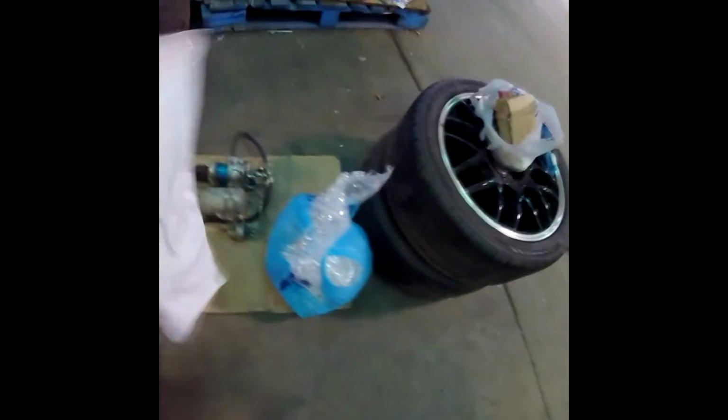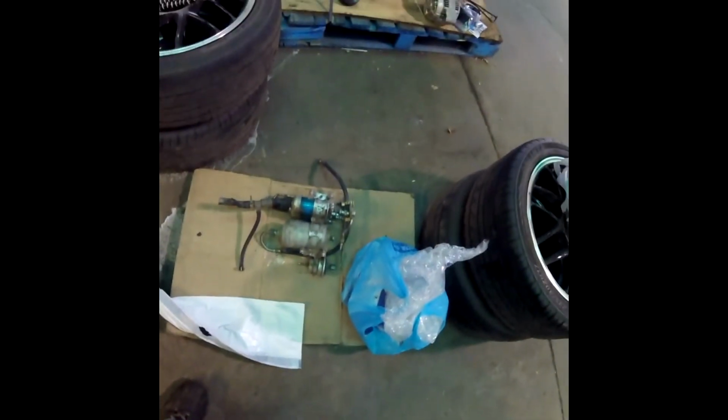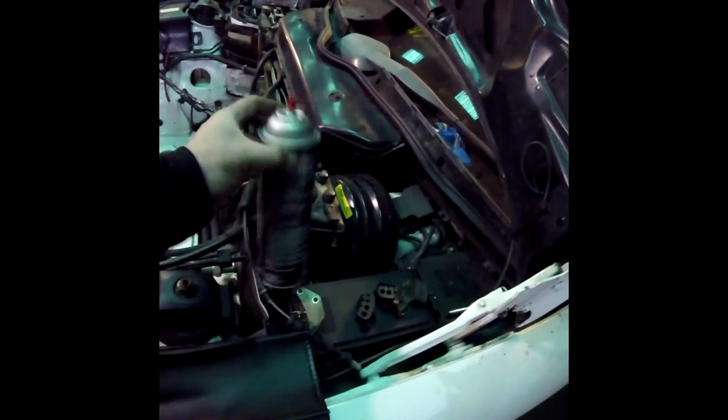I just pieced together the fuel system here, how it hangs underneath. You kind of see after I showed you. It's kind of a neat setup, especially for a 1990, but I'm keeping the dual pumps. I'm going to put this in a trash bag to bring with me because I'm going to take it to have them build me a fuel system. I have the filter and stuff in here and the upgraded pumps. I'm running 504 liter per hour, so it's going to be a little more than I need for a stock car, but I'd like for this to be something a lot better someday. But first, step one is getting it running.